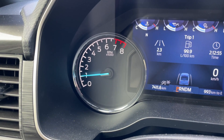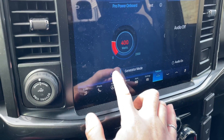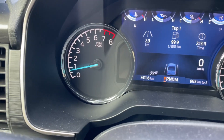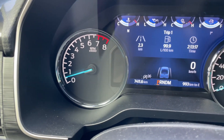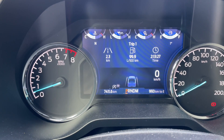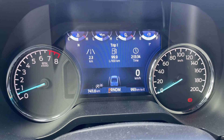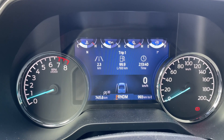Just for interest, the truck was idling at about 1,000 RPM with the generator running. Now that generator mode is off it's slowly idling back down — looks like about 600 RPM. Because I've only traveled 2.3 kilometers on this tank, idling has done terrible things to my fuel economy reading, but we'll figure out the actual consumption after we fill up. There's no noticeable difference on the fuel gauge, which after two hours I didn't really expect.